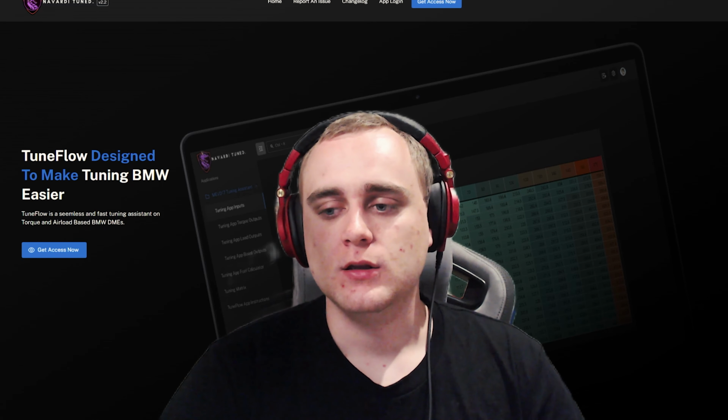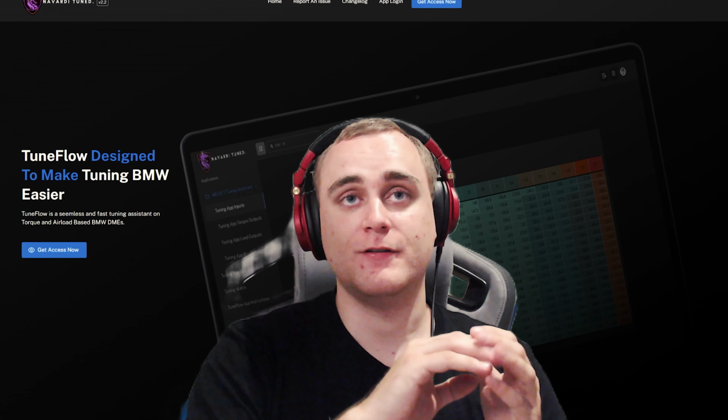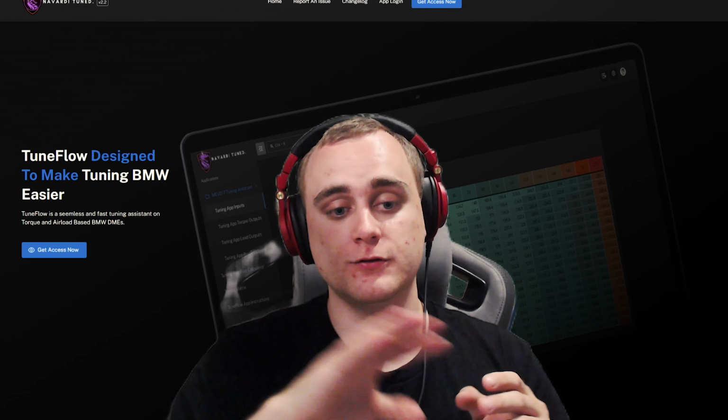You need to have the right components installed, the right mods, the right tune, and on top of that, you need to have the right turbo. A lot of the turbo options out there just aren't right. They might make some power. If anything, they make a lot more torque, and torque is where this engine falls over, right? Torque adds heat, torque adds stress. These turbos peak torque really low in the RPM band. They stress these motors out very quickly. So if you don't have the right tune that makes a very linear sort of torque and power band, you run a very good risk of the thing falling apart and breaking.